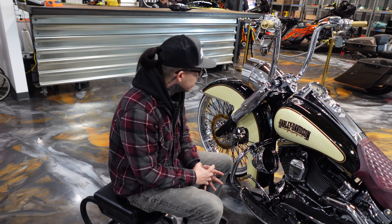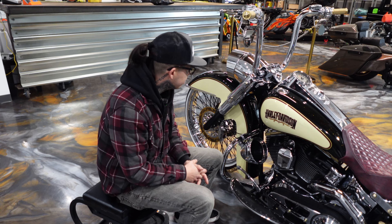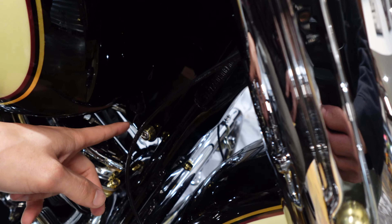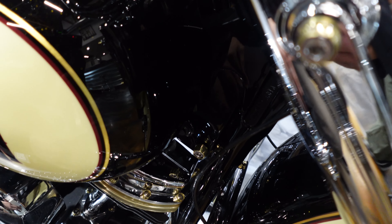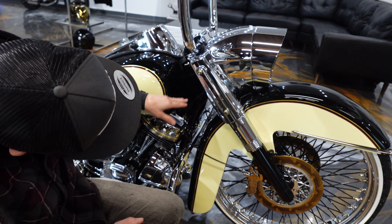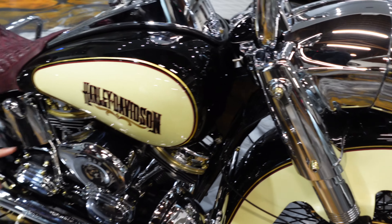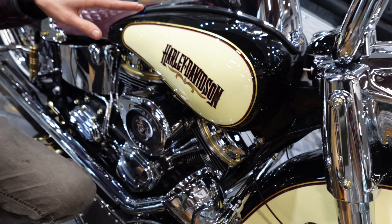We know we're gonna buff this and ceramic coat it — there's a process going on, so we're not too quick to put a lot of effort into getting it spotless yet. Another thing we did right here: we used to have blocks to lift this tank up. So we eliminated the blocks, added full plates inside of there, and lifted the tank up through there. Now we have these block plates — custom — and you can't really tell we added those. It just looks like one long piece of frame.